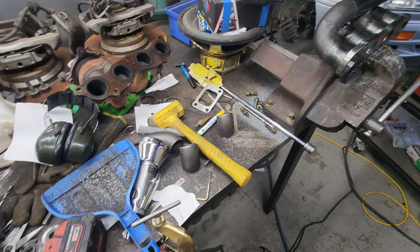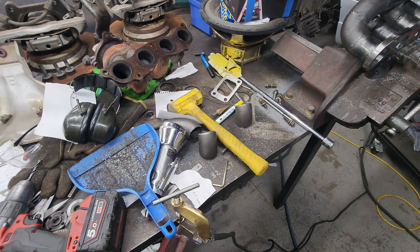Well, this took 47 years and I've made so much mess, but now this flange is cut and die-ground into shape. It's not welded obviously, but that's pretty reasonable - it all matches up quite nicely. Once this is all welded I'll send it to the machine shop and get this faced and get this faced - everything will be nice and flat and good to go. I'll just MIG tack this together for now and then put it all on the car and see how the turbo fits.